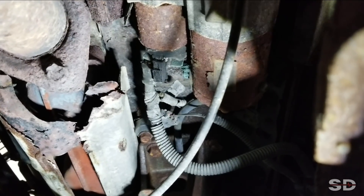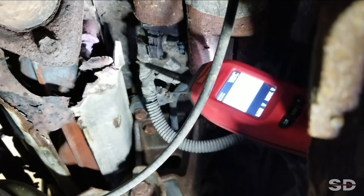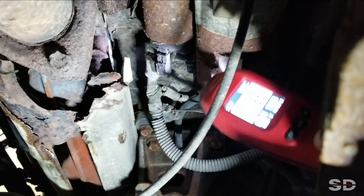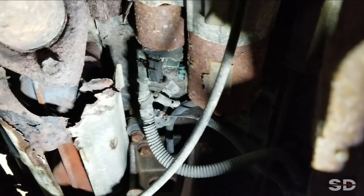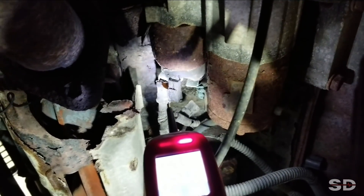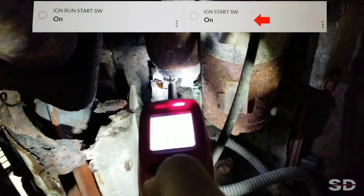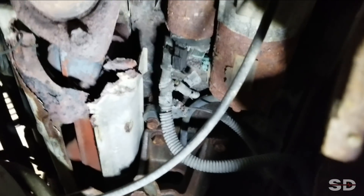All right, one more piece — just want to show you guys something. If you ever get into a bind like this on one of these newer vehicles, right now we have the key on, and I can jump this thing and make it crank. With the key on it should start, but watch — the arcing there was bad contact. I can't get it from the side, I've got to go straight at it. So notice it does not start. In these newer systems because they need a crank input, you actually have to have somebody crank it inside instead of just leaving the key on. Pete, are you ready? Good — crank it. All right, so now as you can see you can move it in a pinch.